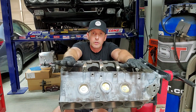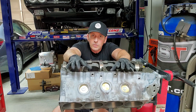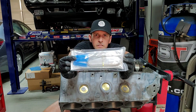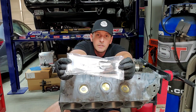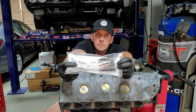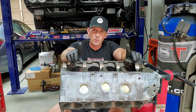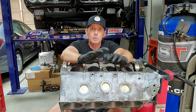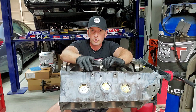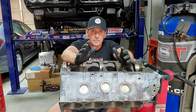For all the orifices in the engine — I removed the oil galley plugs — I bought a brush set on Amazon actually meant for cleaning aquariums. One brush is super long, so it can run up and down the oil galley, which is pretty cool. I'll use the other brushes on various oil ports on the engine with the degreaser, and then rinse it all off with water. Important: after rinsing, make sure you dry it, blow it out with an air compressor, and then hit it with WD-40, because you don't want it to rust.